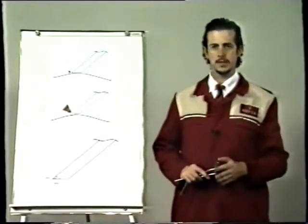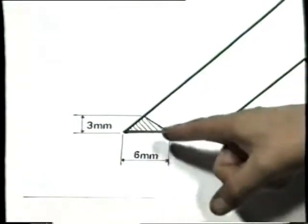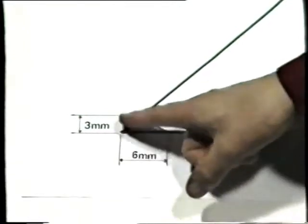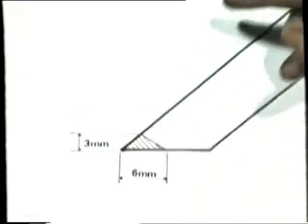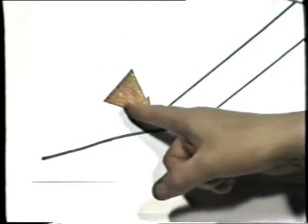What you'll need to do to get over this problem is rework the pickup pipe itself. What you've got to do is file or cut off this end part of the pipe here. You've got to have a vertical height of 3mm plus 6mm along the bottom. With the end of the pipe cut away, fuel can still be drawn up the pipe, even if the bottom of the tank is being sucked up against this bottom edge.